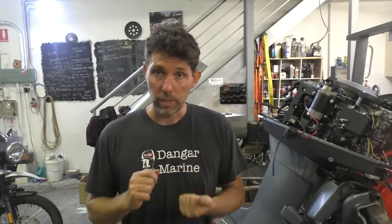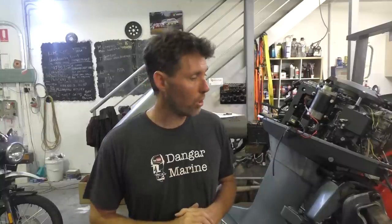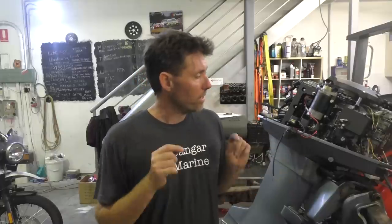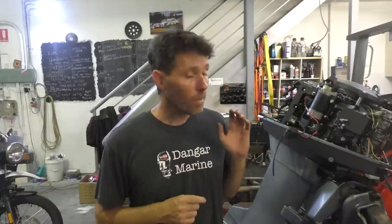To explain what I mean about reversing the throttle direction: I've got this old Yamaha, about 1980-something, and it came with a forward control that was in really bad shape. I had a spare one — the original from the green machine before I put the Honda on — so I thought I'd use that. Turns out that sometime in the late 80s or early 90s, Yamaha went from a throttle cable that pulled towards the front of the boat to one that pushed away, so I can't use this forward control as it is.